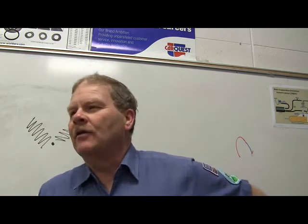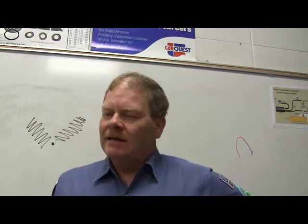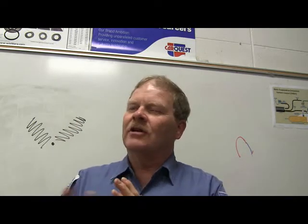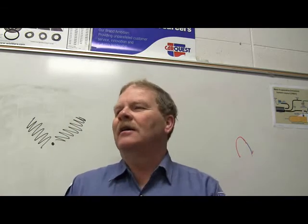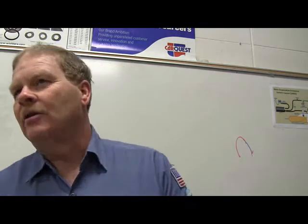So the smart thing for you to do if you're sitting a long time in a traffic jam, and I'm talking about an hour or so, is kick that sucker up into neutral. And it'll keep your transmission from getting hot. Because when the torque converter is shearing that fluid, it's continually getting hotter and hotter. And when you're not moving, there's not a lot of air coming through that transmission cooler.